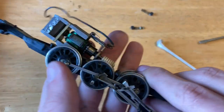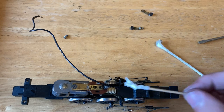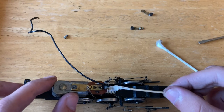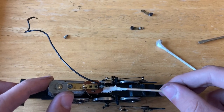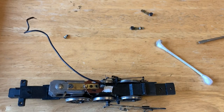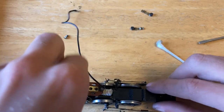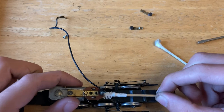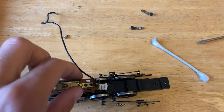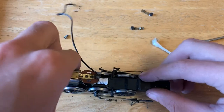Then I'm going to crack open the underside here. Using a toothpick — oh that's quite bad. You just put it on top and spin it around with your hand and then you can get it spread onto the gear. There we go, that should be plenty of grease for the mechanism now, and eventually it'll balance out.